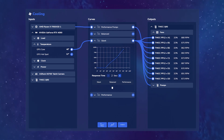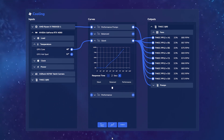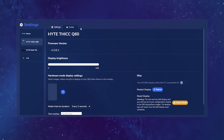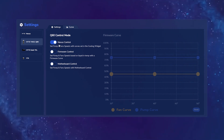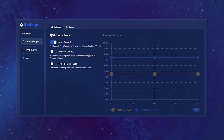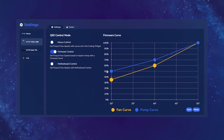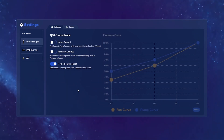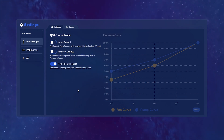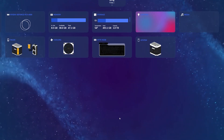For cases where Nexus isn't running, you might ask how do I control the performance of the Q60? For that, hop into the Settings widget. Under the Q60 section there's a different tab called Curves. If you click on that, it's going to let you toggle between what is controlling your pump and fan speeds. By default Nexus is going to take control. However, if you toggle on firmware control, it's going to let you enable three distinct points on the curve that can be saved directly to the Q60 — so anytime Nexus isn't running and it's in firmware mode, it's going to respond to the coolant temperature and ramp the pump and fan speeds according to the curve you've set. You also have the option for motherboard control, so if you plug this into your motherboard header you can use your motherboard software or BIOS to control pump and fan speeds. But for the optimal experience, we do recommend using Nexus to control your entire system's cooling directly.